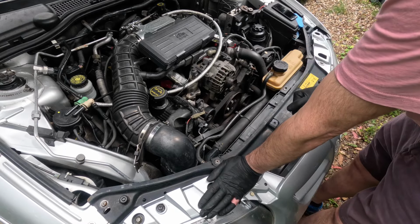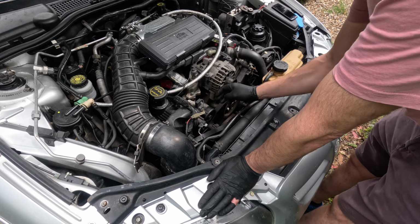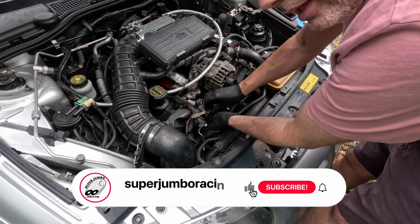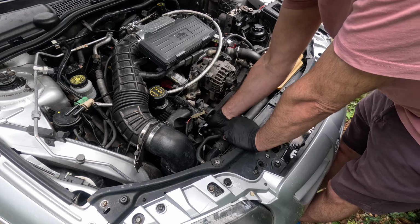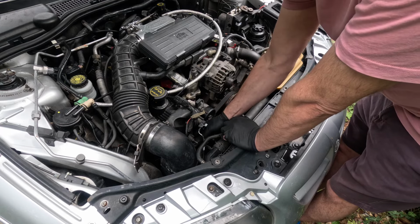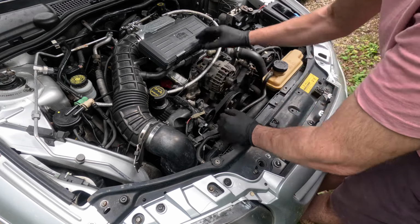So that pulley is noisy. That sounds like my noise. And there's also a bit of free play. The other pulley doesn't spin too freely. It's not noisy and there is no play. I don't think there's anything wrong with the bottom one, but I'll replace it.